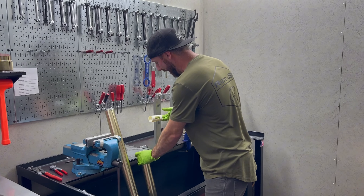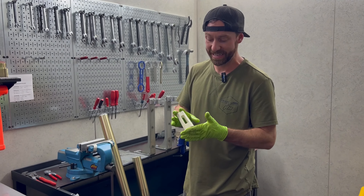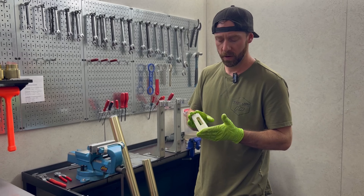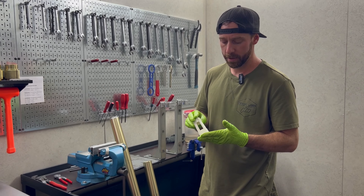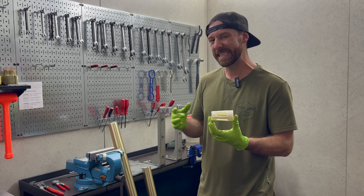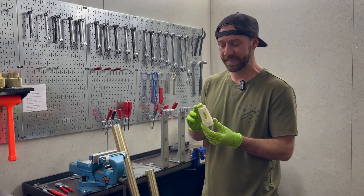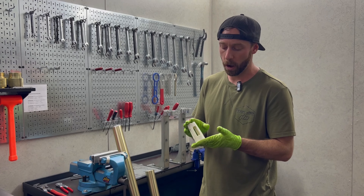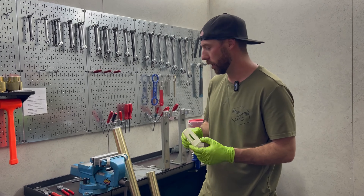So it looks like we got the plastic spring seat, which is very similar to — actually identical to — what the Kawasaki has. I wouldn't say this is a step backward or a step forward, just kind of lateral. Probably cheaper for Showa to make. The metal piston band is gone and it's just plastic now, so it probably slides better on the inside of the fork. The holes are a very similar size to the previous OEM spring seat, so I don't see this offering any more or less damping effectiveness than the previous version.